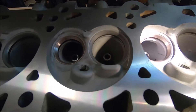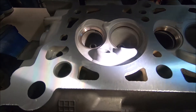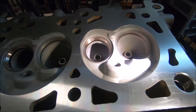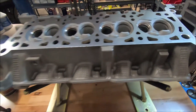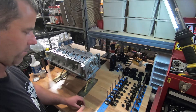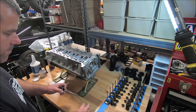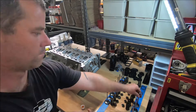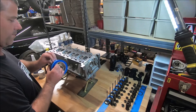I'm done lapping all the valves in. They all look good. The gray line may not be showing up too well on video, but it looks great. Lastly, you want to make sure you wipe it out really well and blow it out - whatever you need to do to make sure there's none of that valve grinding compound left. Now we can put the valves back in order, and I'm going to use a little cap of oil and put a little bit of oil on the stem. Now I'm going to put some blue tape across the valves to hold them in when we flip it over.